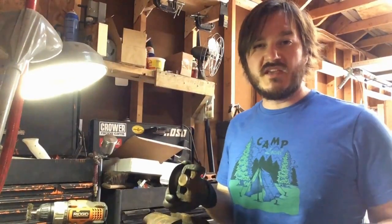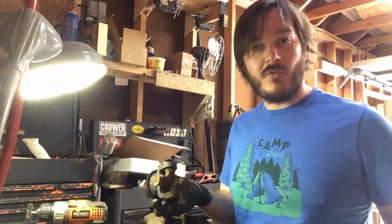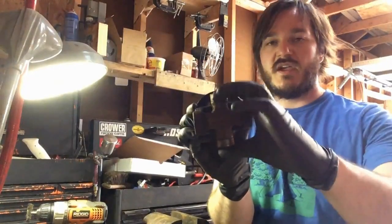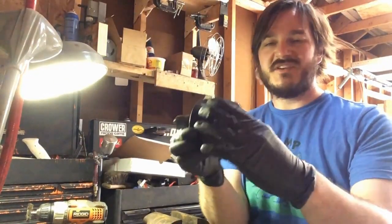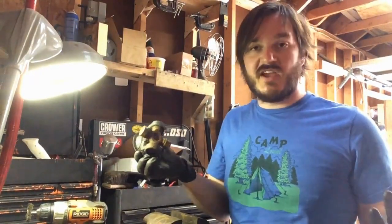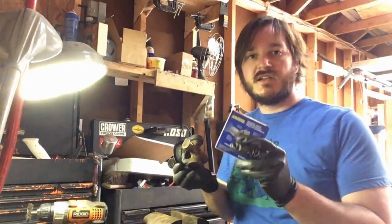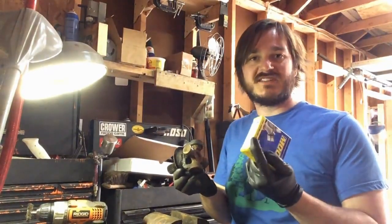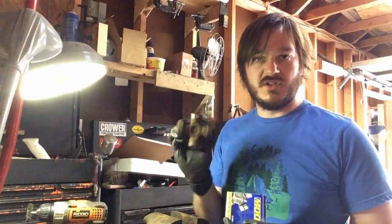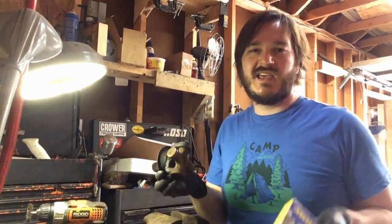So being there was a case of one of those, while I'm in there. The U-joints on the swing axles looked kind of cruddy. I mean, they feel all right, but again, while I'm in there, it's a 58-year-old car, I may as well replace the U-joints. So I got two new ones, and the cool thing is these come with grease zerks, so I can service them. These are a non-serviceable U-joint, and for $10, I might as well.